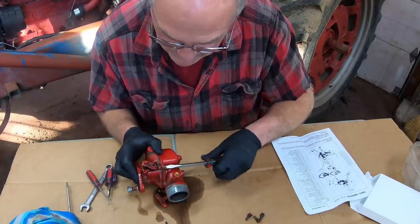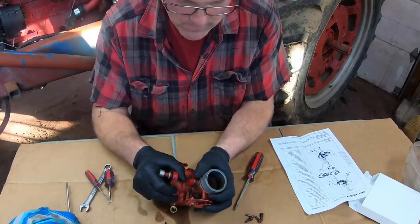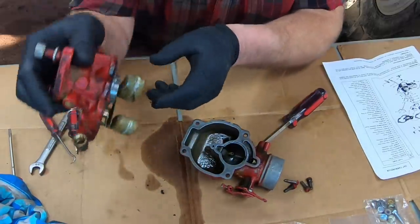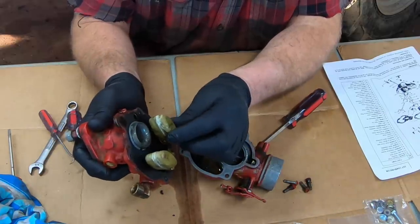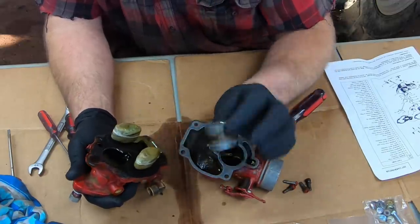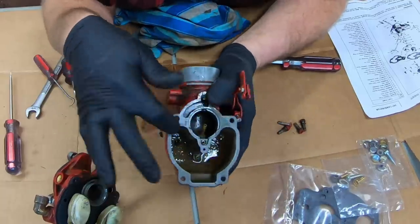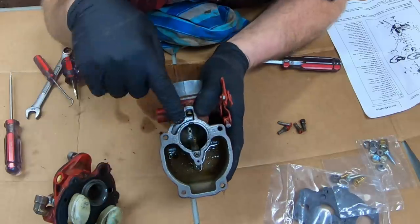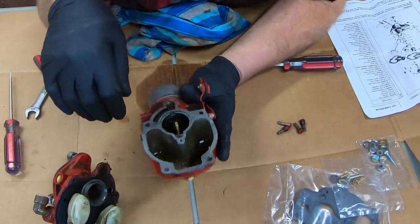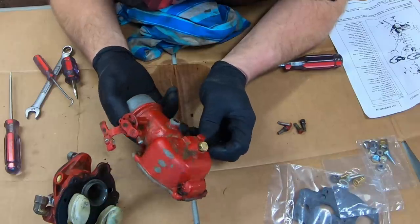That's not a factory screw. It should come right apart. So this is the float that regulates the fuel level in the bowl. The bowl fills with fuel through here, and when the needle valve closes as the float raises up, it keeps the fuel at the right level. This is the venturi that just fell out, which is the thing that allows fuel to get sucked into the airstream by magic. We'll do the easier half first. In the fuel bowl we've got some crud in the bottom — not too bad — and then we've got the main jet here, which we'll have to remove and clean.